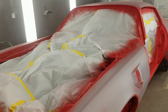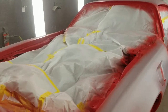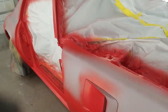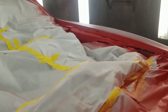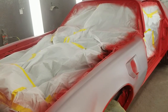Next segment I'll have this clear coated. I've got to finish the base coating and then I'll clear coat it. I'm using Shopline JC 6700, which is a high-solids clear — I love it. It's very, very slow drying, especially with slow hardener. It usually takes about four to five hours to cure, so once I spray it, that's it for the day. Next segment will be this nice shiny Buccaneer Red Trans Am.